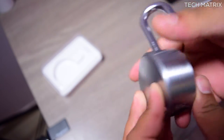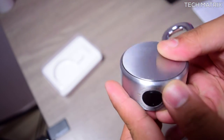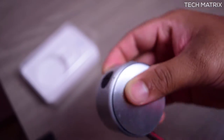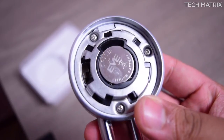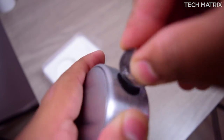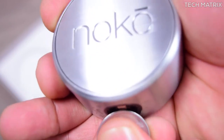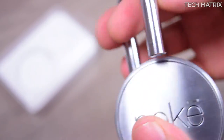Changing the batteries was a bit tiresome. First you need to unlock the NOKEY, then at the back press down very firmly and rotate the back plate to the highlighted white dots and it will come apart. Here you change the CR2032 coin battery and put it back. If the battery has completely dried out, you can unscrew the base with any coin and keep a CR2032 battery at a 45-degree slanting position to jumpstart the NOKEY.